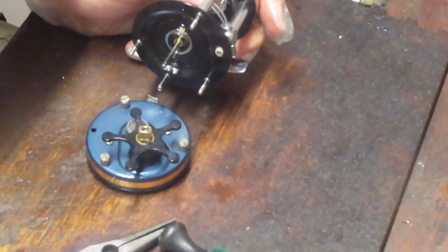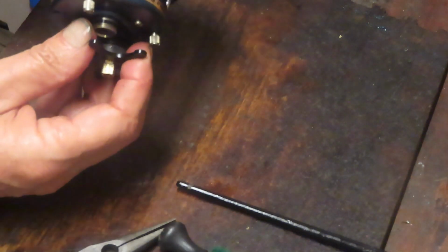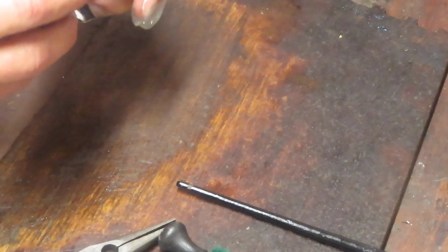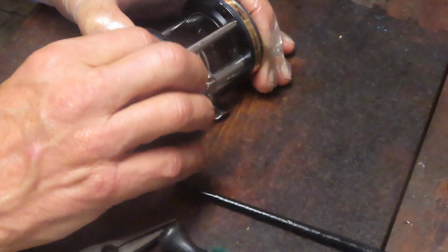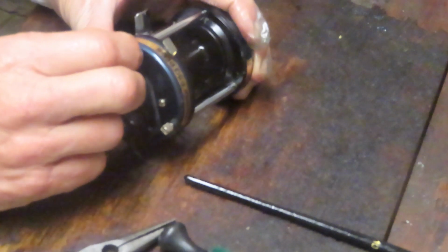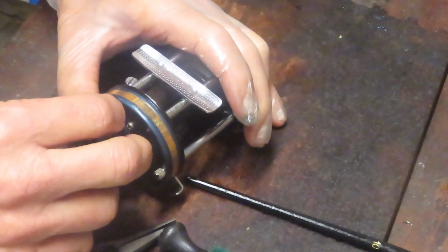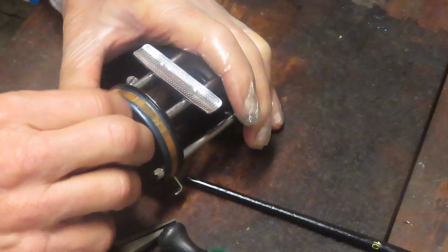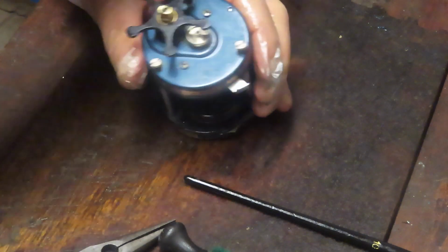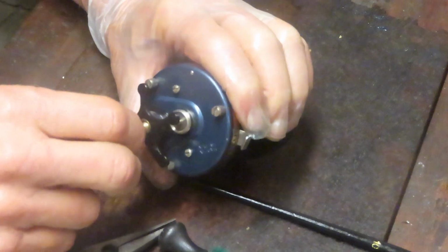Okay. Got that back. We're going to take this, put a little bit of grease onto the axle shaft. Reinstall. That went on easy enough. You want to check the brake. The brake is liable to get trapped again. We know we're down 1 brake. I'm going to take the handle or the gear shaft screw, put that back in.